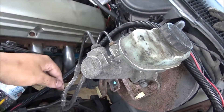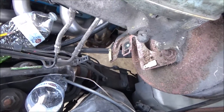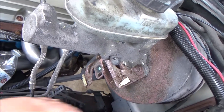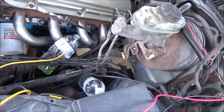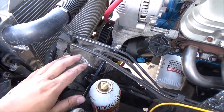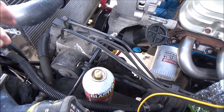I'll run a T-fitting for the front and back lines, and I may just include a line lock at that point since I'm going to do some custom lines anyway. That will get the ABS module out of the way — I'm not really interested in ABS on this car right now.